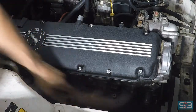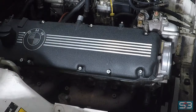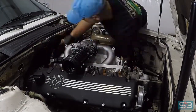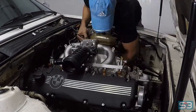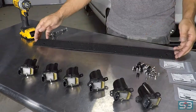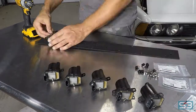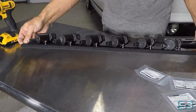These are the two bolt holes for the exhaust manifold — the front manifold and the back manifold are exactly the same, and they've got these recessed holes where the exhaust shield is going to go. Now I'm going to get the coil packs mounted. I went to Bolt Depot and picked up some standoffs — nylon standoffs, one centimeter, as well as some M5 bolts and M5 nuts with the nylon insert. Going to start putting these together. There it is — coil pack bracket loaded up and ready to go.